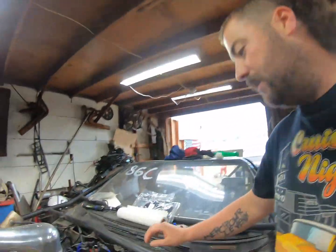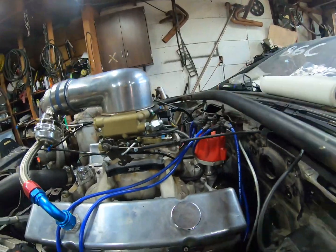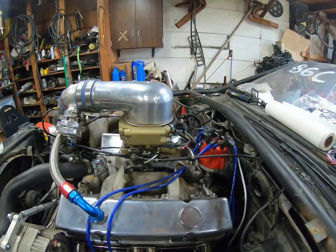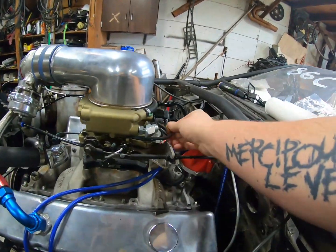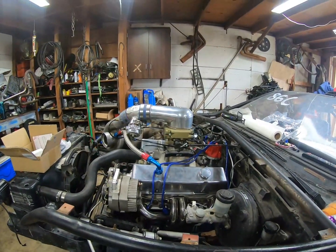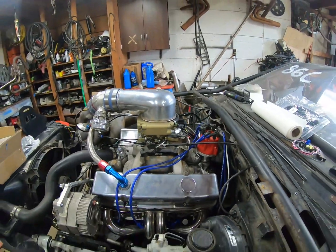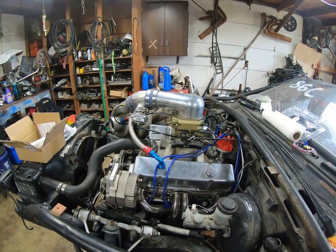I got some fittings. I'm gonna put an 8 feed line on here. It came with the 6, but I'm just not satisfied with that. I'm gonna put an 8 on there so I don't have to worry about it at all. Just doing some reading, and they said in order to get the 650 you actually have to have an 8 the majority of the time feed. So I don't want to deal with that. I just want to have it right off the bat.